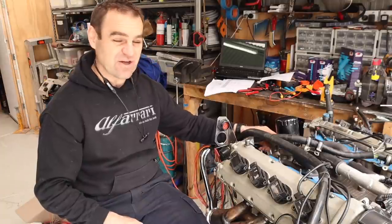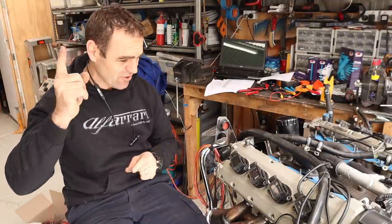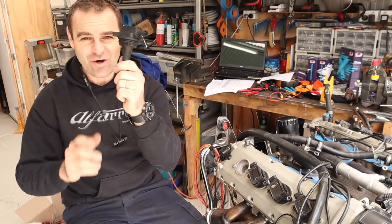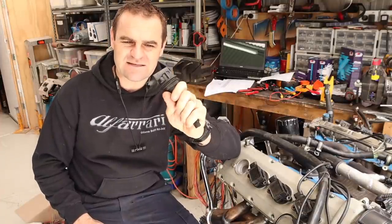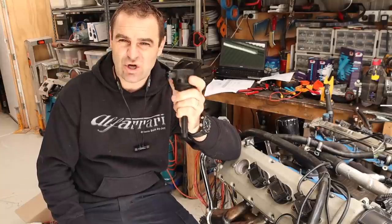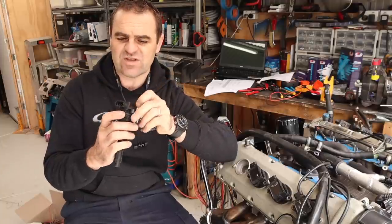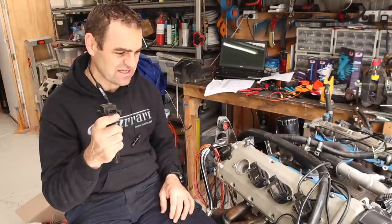Another thing that I missed, and one of my eagle-eyed viewers, Eric, picked up. Thank you very much for reaching out. These coil packs. Not all coil packs are built the same, and particularly on some of these older engines, some of them don't have internal igniters. So basically they need an external igniter unit to run them. I falsely assumed that because this had three wires, it had internal igniters, but that is not actually the case.